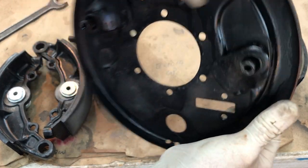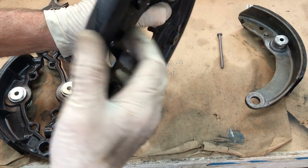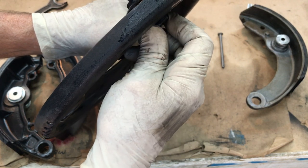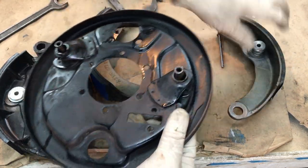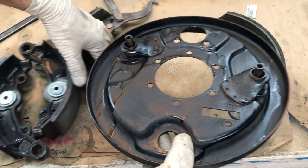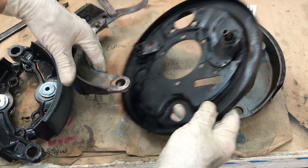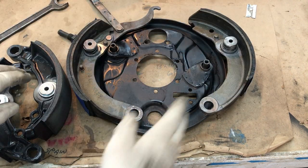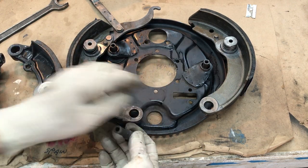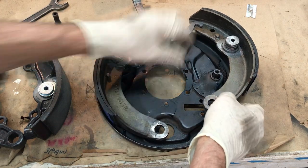The threads are actually a combination of stamped metal pieces riveted together to make pseudo-threads. If you try to force the pin in when it's misaligned, you're cross-threading and ruining those threads — and there's not enough material to re-thread with a die. If you cannot screw this pin in by hand-tight, something is out of alignment and you need to find the problem. You cannot force the pin. This applies to both front and rear — different length pins, but same pseudo-thread design.